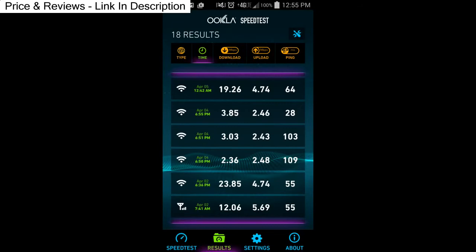Now for the Wi-Fi test. Going back to the WNDR 3300, we will test the 2.4 gigahertz band first. As you can see, the tests were all over the place, but in general the download speeds are in the teens to 20-ish megabits per second range. Upload speeds were variable as well, and ping could skyrocket to 100 milliseconds sometimes. All tests were performed at approximately 30 plus feet away from the router, to help provide a basis for performance at a distance.